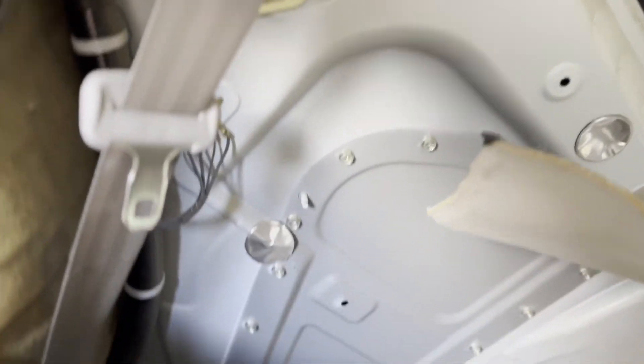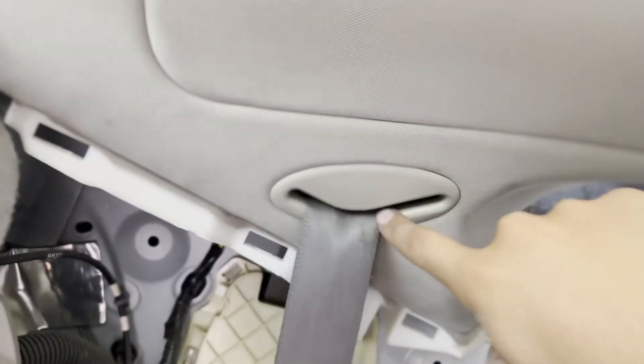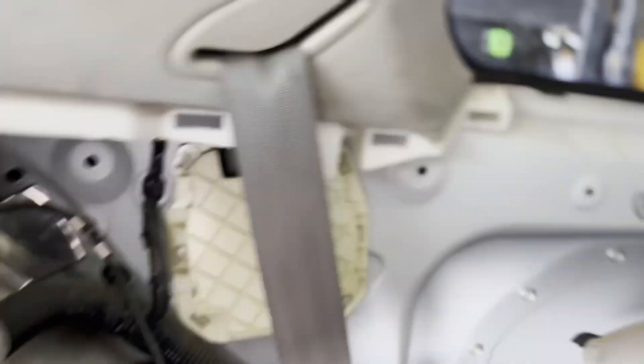So after hours of strenuous labor we took off the side panels, or whatever they're called. You'll see people in videos take this part off with the rear seatbelt, but you don't actually need to do that. The b-pillar can stay on, this part can stay on, but you're gonna need to disconnect these wires from the headliner because they're all taped on. There's a bunch of velcros up here that were attached to the ceiling - you just need to slide your hand back up in there and start pulling it down. You don't actually need to take these back pieces off unless you're gonna wrap or paint your headliner.